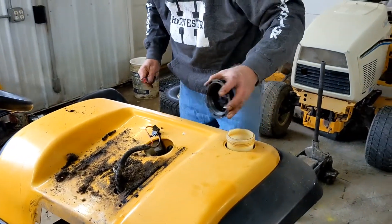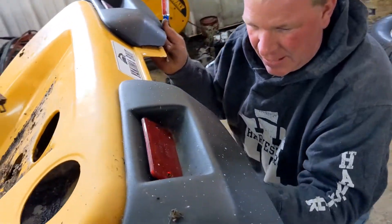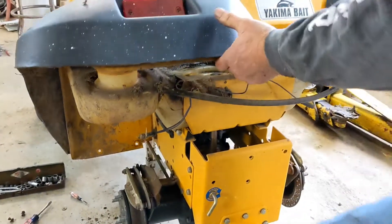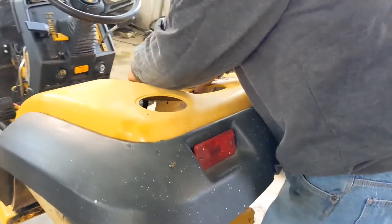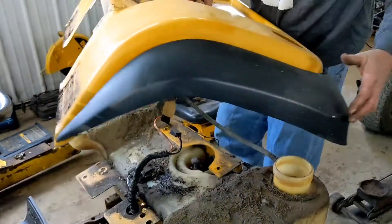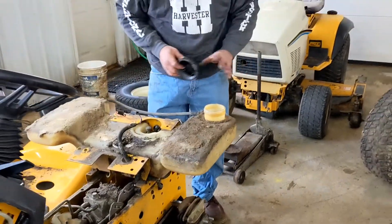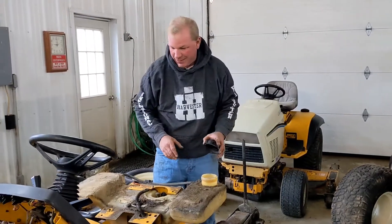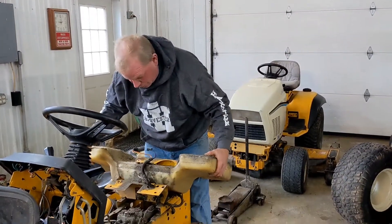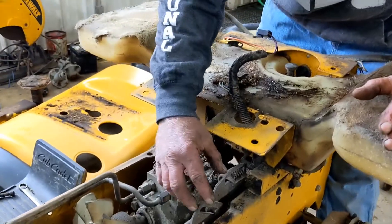Okay, now we have the lights and the fuel cap to remove — obviously everyone can remove a fuel cap. We're going to flip them up slowly and now we're into the rear light. This light here has already been disconnected; that one is now disconnected and we're going to bring it up through. This is where it gets pretty hairy — make sure you do not disturb these wires. I put the fuel cap right on. One thing I don't recommend is putting a rag down in the fuel tank — if you lose it in there, you're in big trouble. Your fenders hold your fuel tank in.